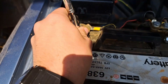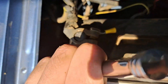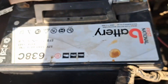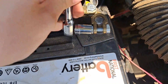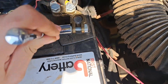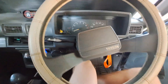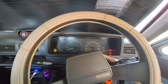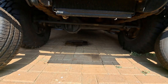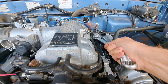Future Ron here — it's been 24 hours, so let's see if this thing will start. Just got to tighten up the battery terminals. Get that primed. I smell fuel — I smell fuel. Yep, fuel. I missed something. I think I forgot to tighten that down — that's not tight. Because that has an aluminium crush washer, logic dictates that needs to be pretty tight in order to seal.